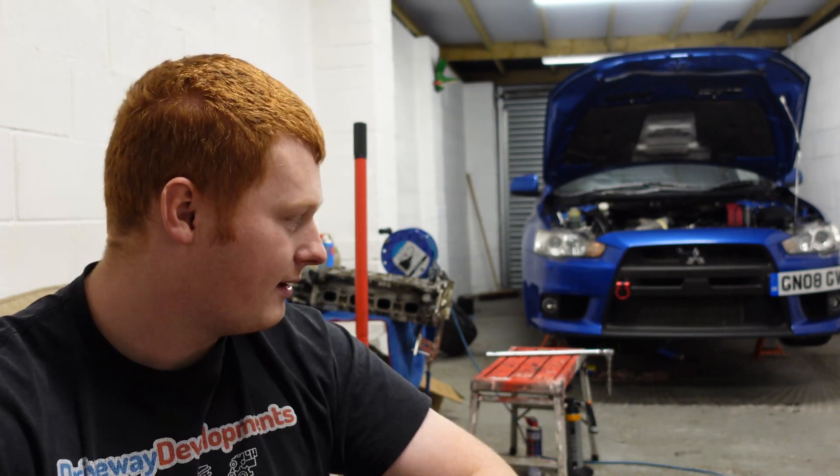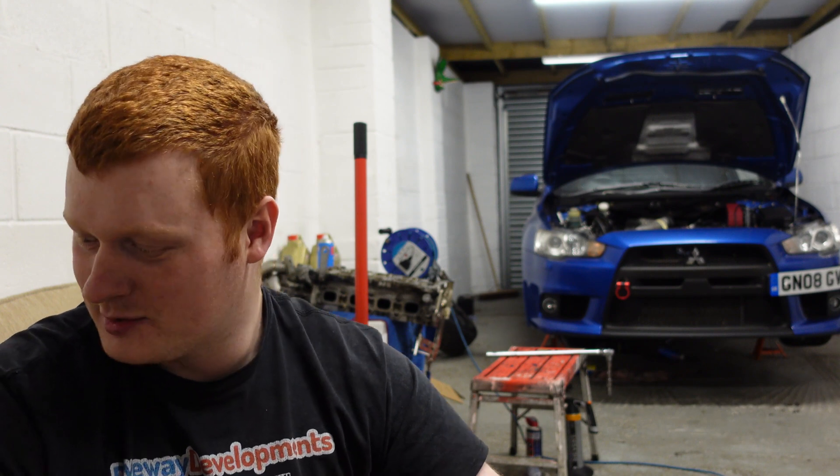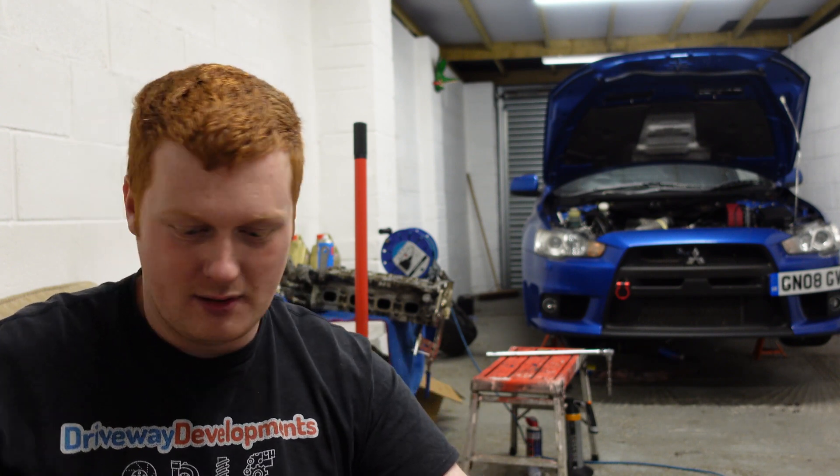The reason I'm fitting them to Steve-O is we're running more aggressive cams, so the cams might open the valve further, longer, and require it to come in and out faster. It's the spring's job to actually pull that valve back in before the piston hits it. I've got parts all over the garage and it's nice to actually hit that halfway point where the pile of parts is going to start getting smaller, not bigger.